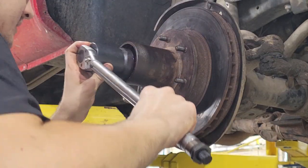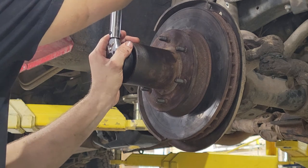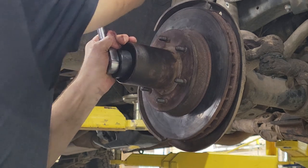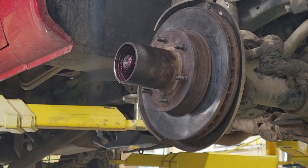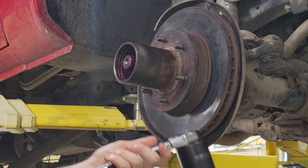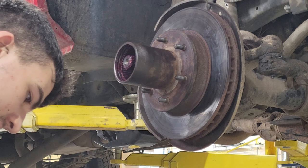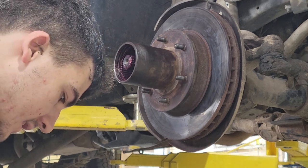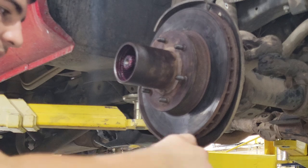So, the next thing you do, go up here to 12 o'clock, and you're going to take it to 9 o'clock. Come on. There we go. Right there. So, from here to here, that's 90 degrees. Now, getting rags again, because like I'm saying, this is a greasy, greasy job. And adjusting a torque wrench, you've got to twist the bottom, and this being stainless steel, it's slippery. Go to foot-pounds, we're going to lower it down again. This time we're lowering it to 30 foot-pounds. So, got that set there. Spin my little bottom knob tight. Wipe the grease off of all this.